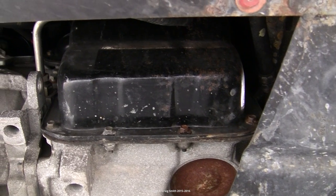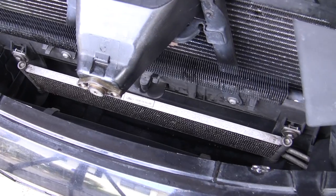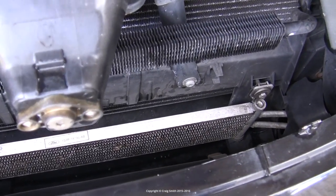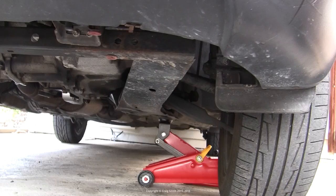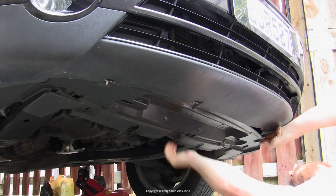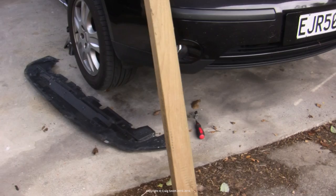The gearbox and setup is more or less identical in all of those cases, so long as the gearbox has an external oil cooler, which most of them did, and you'll be able to follow the same procedure shown here. The first thing you'll need to do is lift or jack your car so that you have access underneath it, and you'll also need access to the oil cooler hoses, which may involve removing an undertray like this black plastic one here, which you can see I've already taken off this Mondeo.